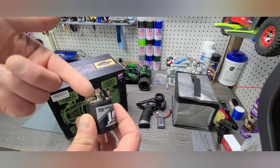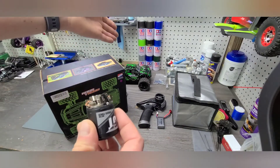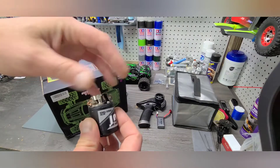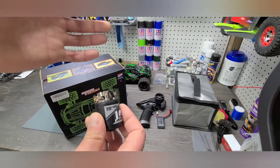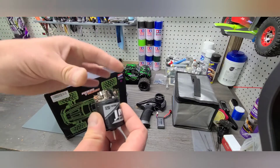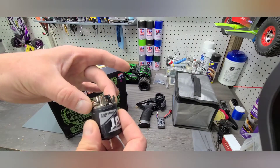There are brushes on either side and they actually contact a component inside the motor called the commutator — so there's a physical contact there. That's obviously a wear item, and with the motor that's in that vehicle, it's a closed system. You can't replace components on the motor; you have to replace the motor. They're also not as efficient — there is friction between the commutator and brushes.